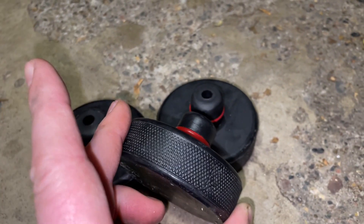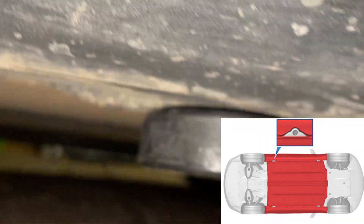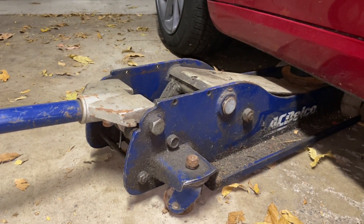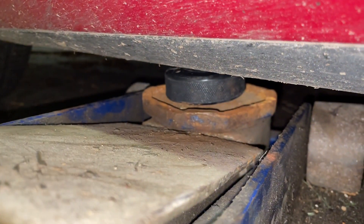The other thing you'll need are some jack pucks. This is unique to Tesla and must be used when you or anyone jacks your car, otherwise you can destroy the battery. You can find four spots for these under your Tesla, as shown here. Next, you'll need a solid jack, and possibly a low-profile one, depending on your jack and any body enhancements you make to your Tesla.